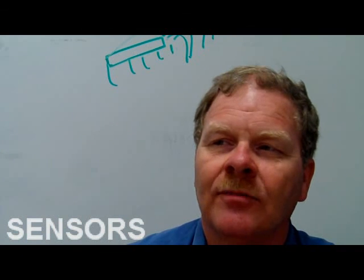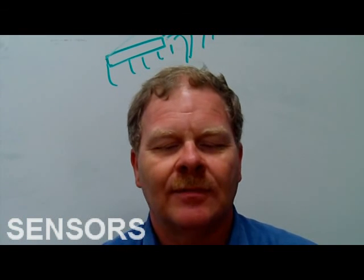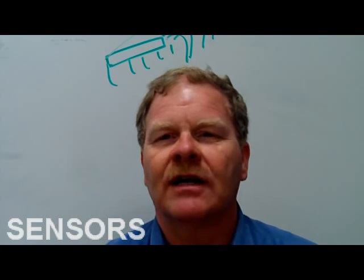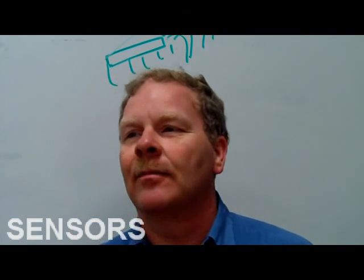Sometimes these guys would be fighting with a MAP sensor that wouldn't be reading right. Be reading like a really crazy pressure. And the guy would say, man, I must have a bad MAP sensor. He'd go throw another MAP sensor on it, and they would read the same way. What's up with that? And I said, there's a hurricane coming. We got some air pressure deals going on here. You've got to be paying attention to the barometer so you'll know.